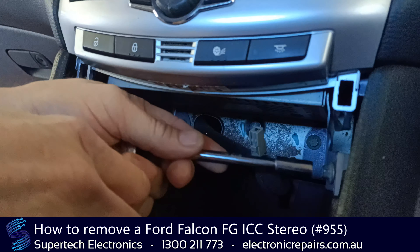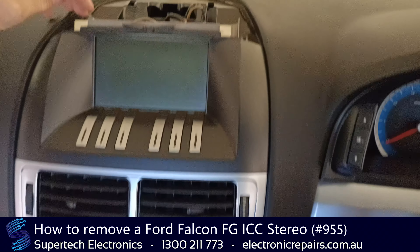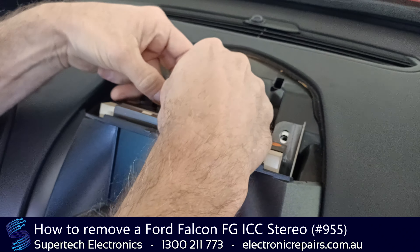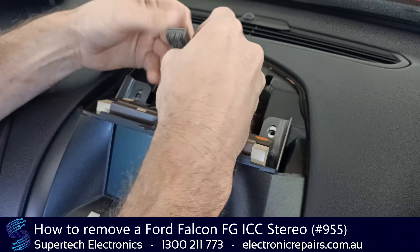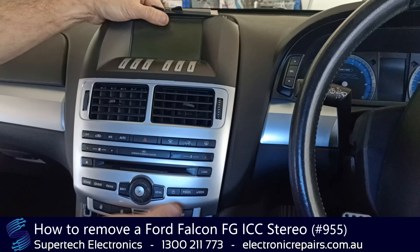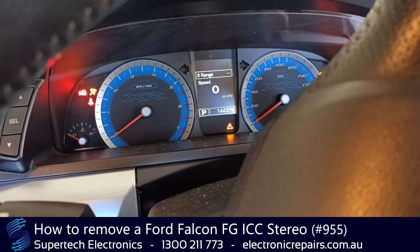Once we've got those four screws at the bottom, we'll need to remove two Phillips head screws at the top, and also remove the electrical cables. You get those out by pressing that middle pin and pulling it straight up. Now that we've removed that, we should be able to pull this whole unit out as a whole piece.